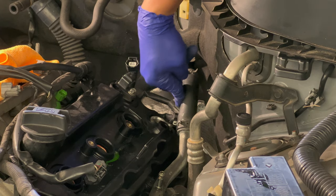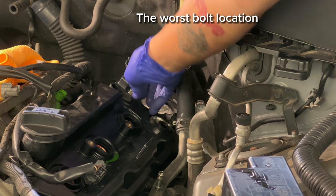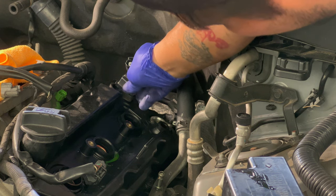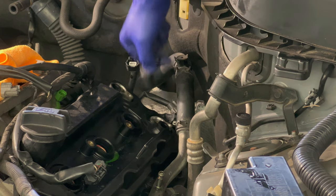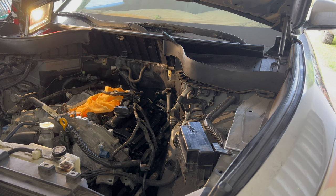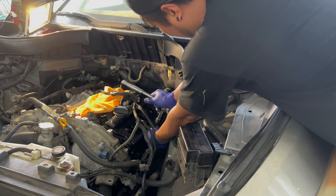There is a tightening spec and sequence — you're going to do that cross pattern thing. We're going to have to torque it by spec so it's at the right tightness. There we go. You can see the seal — it's not even sticking on, it's already coming off. It's time to replace that one. I'm cleaning it off, hitting it with carb cleaner, then washing it down. I'm going to spray carburetor cleaner — choke cleaner, parts cleaner — and rub down the parts where the seal will seat on the valve cover, just to clean it off and remove any excess oil from leaks.